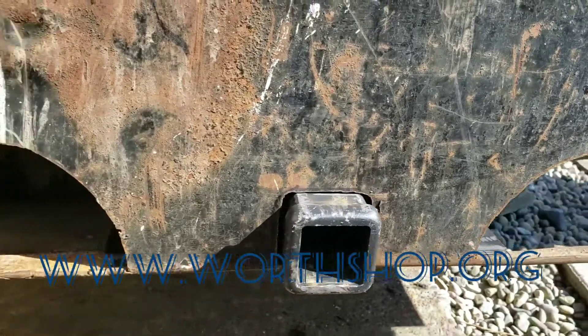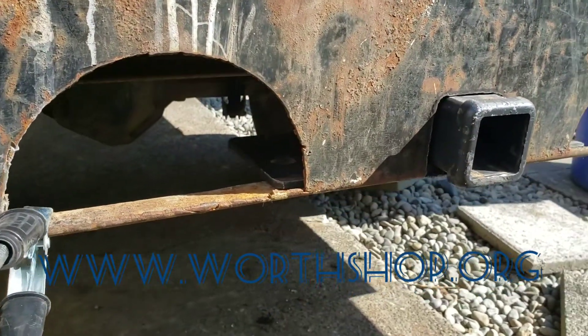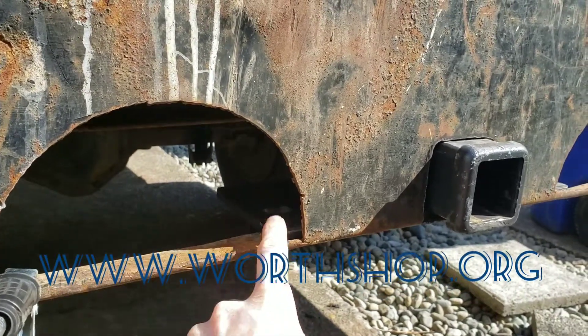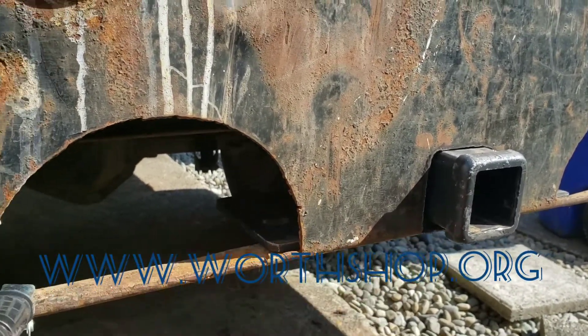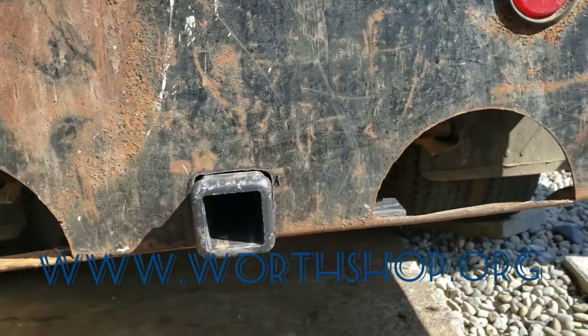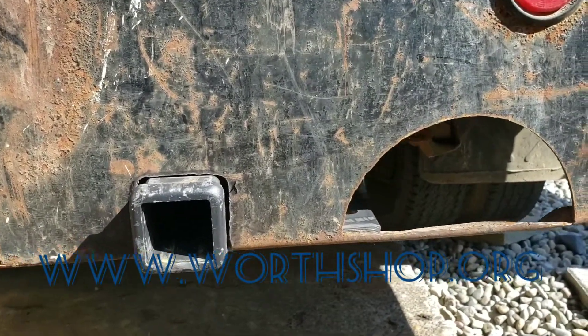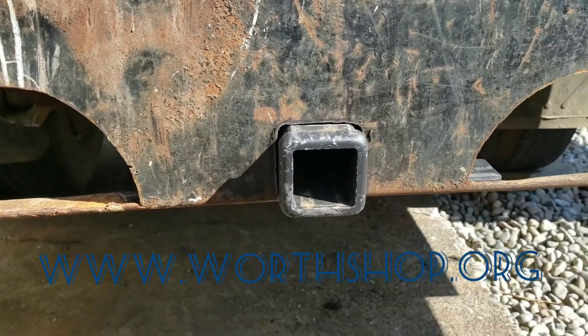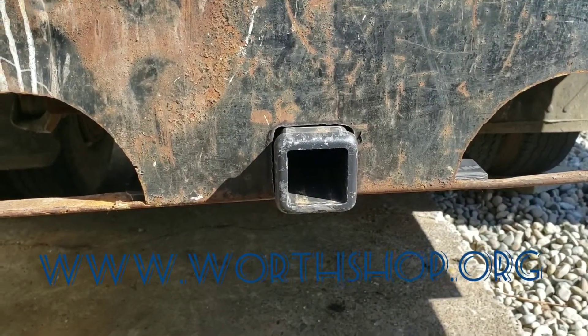So there it is — I got the whole cut done. I got the trailer hitch up in there. I ended up doing it upside down. I felt like putting the longer part down here against this rail of the bumper was a little stronger. I ground down where I thought I was going to be able to weld on the back side, and we're going to go ahead and get this burned in.